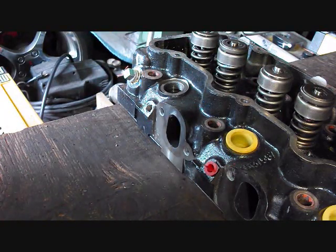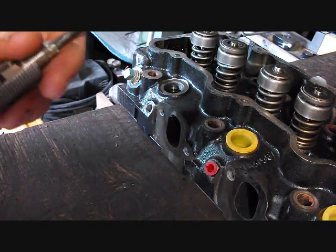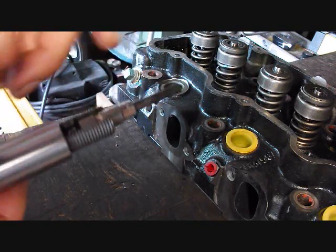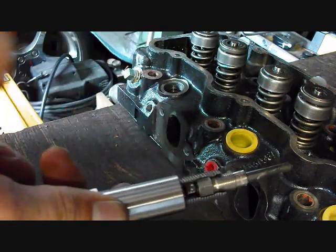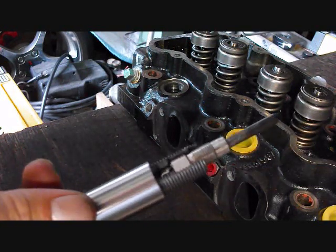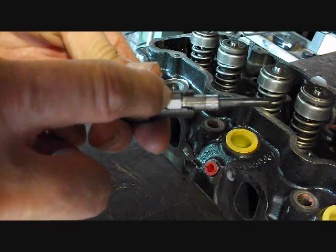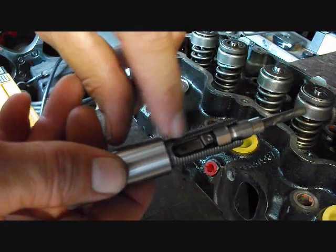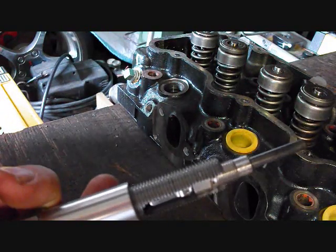info@LeroyDiesel.com. And just to go back to the other types of glow plugs, for example, on the older Ford 6.9 diesel, that also uses a 10 millimeter head or 10 millimeter hex on that glow plug, and I've had customers report back to me that it will pull those glow plugs just fine. And I understand that on some Volkswagens, but basically if you've got a 10 millimeter head, and as long as the other portion will fit in the tool is what I'm getting at, it should work for you.